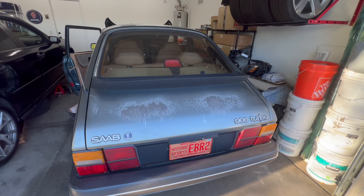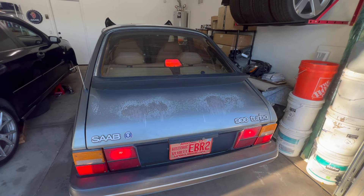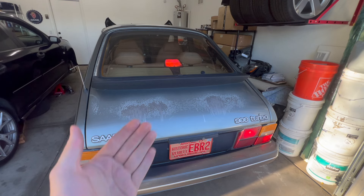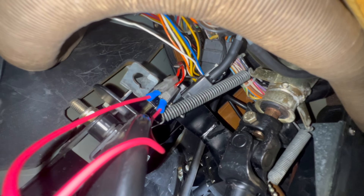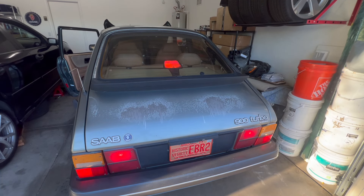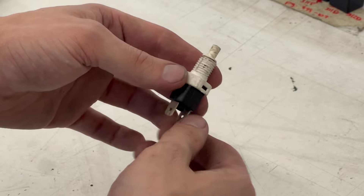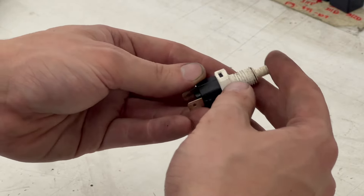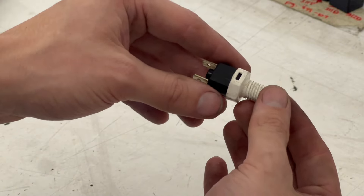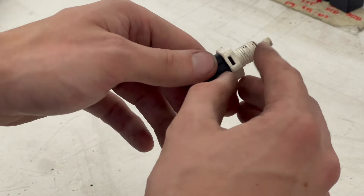So I think I'm going to start just by removing this. There are the two wires that plug in, and then it should simply unscrew with that little metal nut right there. It looks like how this is lined up is working as it should — the plunger is getting depressed and extended as the brake pedal moves. So what I'm going to do is take the two female ends that these plug into and stick a jump wire in to see if that causes our brake lights to come on.